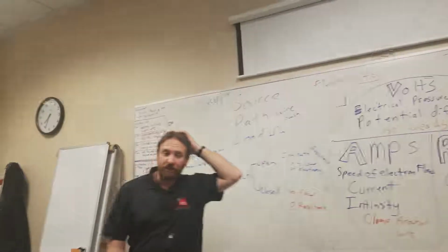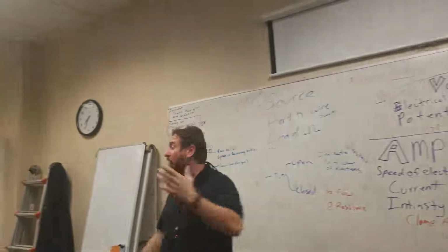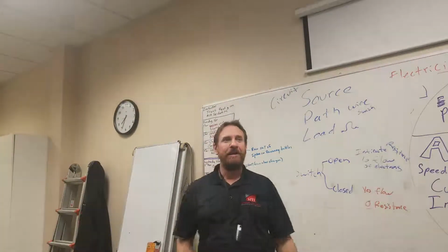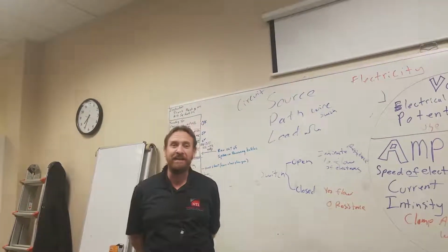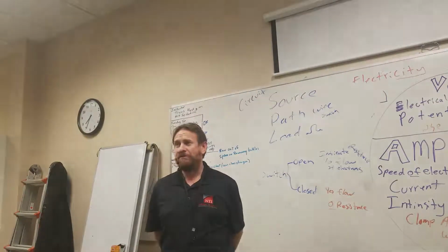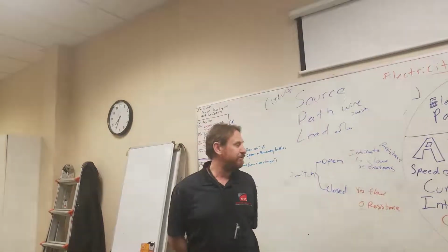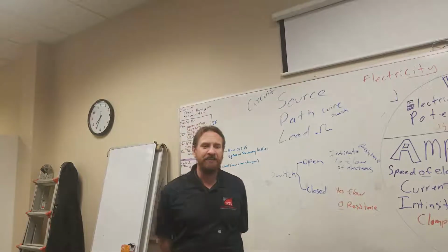Now, these words are tricky. The only way you're going to start learning these is studying them. Make some flashcards. Study them. It's a must that this gets into your head, because this is how everything's worded in HVAC. The switch is open. The switch is closed. What's the resistance of an open switch? Infinite. What's the resistance of a closed switch? Zero. If you get a number other than that, then there's going to be a problem.